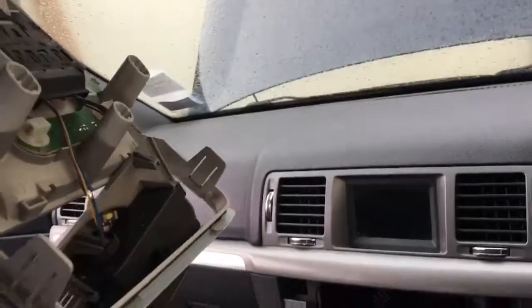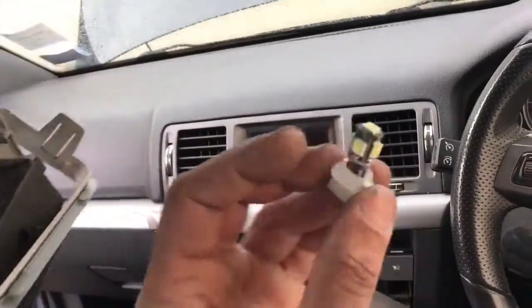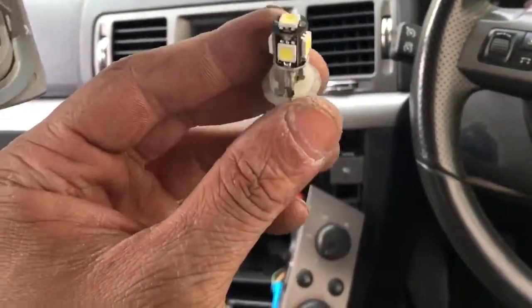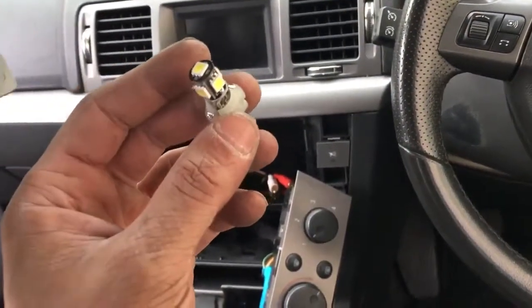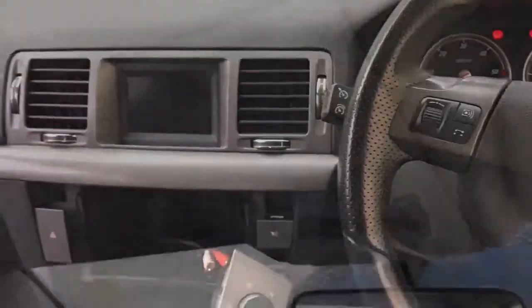So for the front of the Vectra, it's easier to just get this complete thing out, because it allows you to just install the bulb like this. Just to tell you, what should be in here are T10 bulbs. However, if you press hard enough, like I did, you're able to fit T15. So your parking light, for example, you can use in here, as long as they are small enough. So everything is back as it should be.